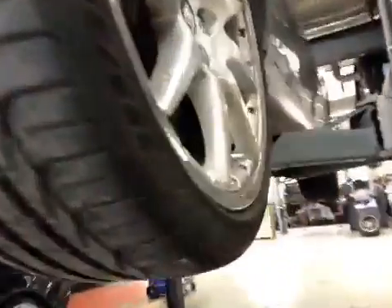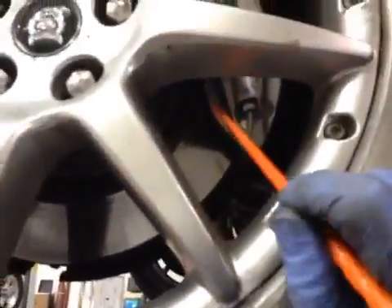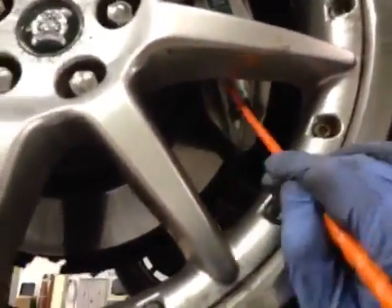No signs of a foreign object inside the tyre. Your front discs — on the front side are in OK condition, but on the back side there is corrosion on the discs. Your front brake pads are roughly on about 6mm, so the pads are in amber, discs are in amber, and your tyre's in green on the health check.